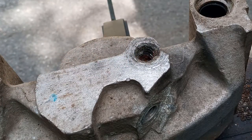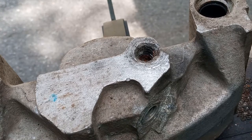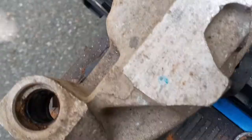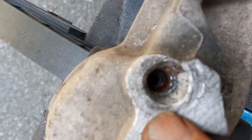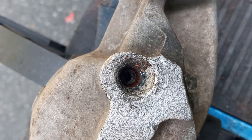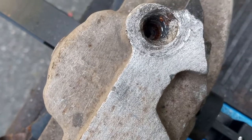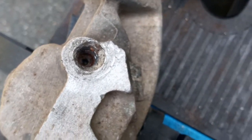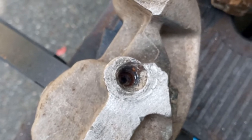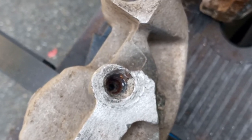Ultimately you don't really want to see any shavings at all — this really shouldn't be taking off material, just reshaping it. But with the damage this has had previously, there's going to be at least a little bit. If you take a look down inside, you can see that the threads themselves are significantly better. There's a conical seat down there that will mate exactly up to the bleed screw when it's fully engaged. The problem is that at the bottom of that hole, there's a bunch of corrosion. I'm going to use a Dremel and a small brass brush and give it a really good cleaning, then we'll test it.